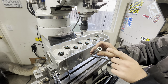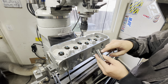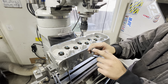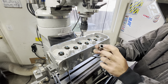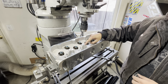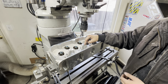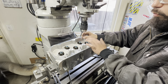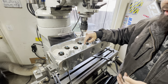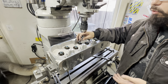What you just watched me do is I set the head up in the fixture and squared it up front to back using a wrist pin. This is a ground surface. The ends of the wrist pins typically are not — they're usually just lathe turned — so you're not going to know whether the machined OD of the wrist pin is perpendicular to the sides. What I did was I ground one of the ends perpendicular to the OD of the wrist pin. So now this is my tool that I'll use for indicating in off of rocker stands, and I'll be able to reference off of this surface as opposed to going off of the threads. In a perfect world, the threads should be machined on the same plane as the rocker stand itself, but a lot of times if the heads have been worked on before, you're not going to run into that.